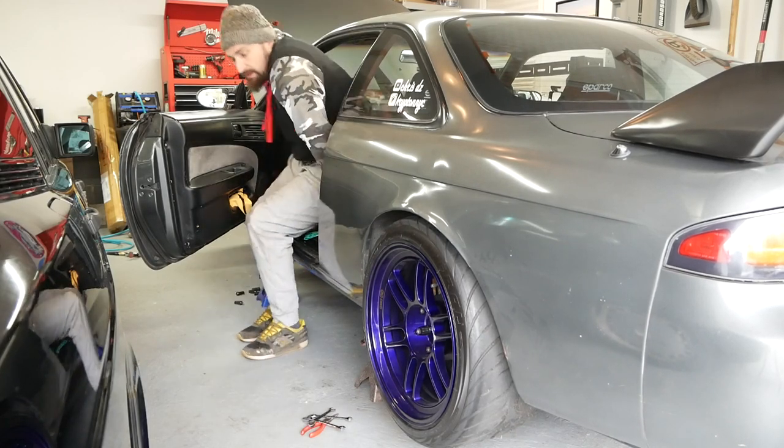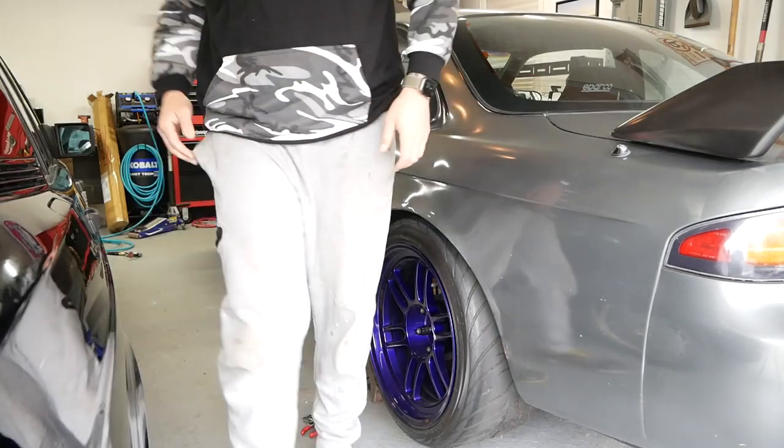The clutch is adjusted, though I might give it a turn back the other way — I don't even remember which direction I turned it. Two things I've noticed: adding that ground seems to have made the starting issue slightly better — it doesn't take as many attempts to crank over. That's leading me to believe I'm kind of on the right path with it just being a grounding issue, though it could still be something completely different I'm not even thinking of.